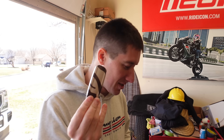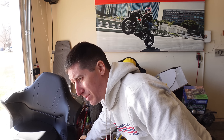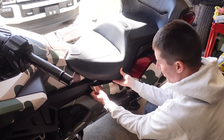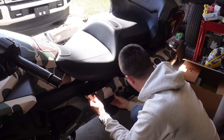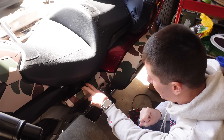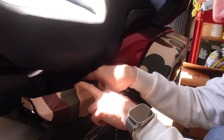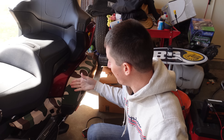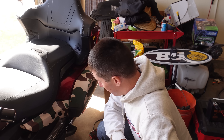When your Gold Wing has a completely dead battery, you're in trouble. The key is a proximity key for the saddle bags — you push the little button and the saddle bag opens right up, then you can pull the cover off, which is hiding the battery. But if the battery is dead, you can't open the saddle bag electronically, so you can't get the cover off. What you have to do is get your negative from your jump pack on the terminal, then snake a wire back in there to give you enough power to open the saddle bag. BMW figured this out and added remote jump terminals to their touring bike — if you're going to have electronic saddle bags, you need a way to get them open if the battery's dead.